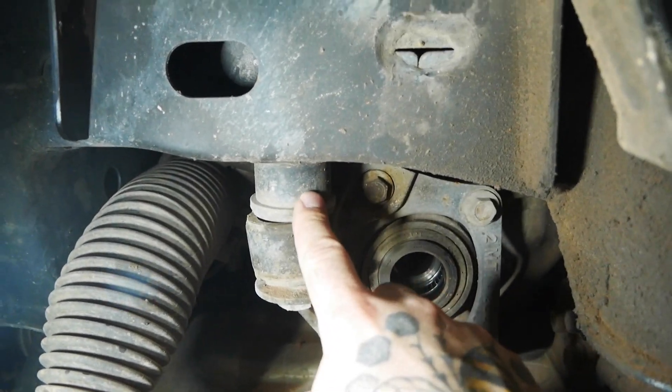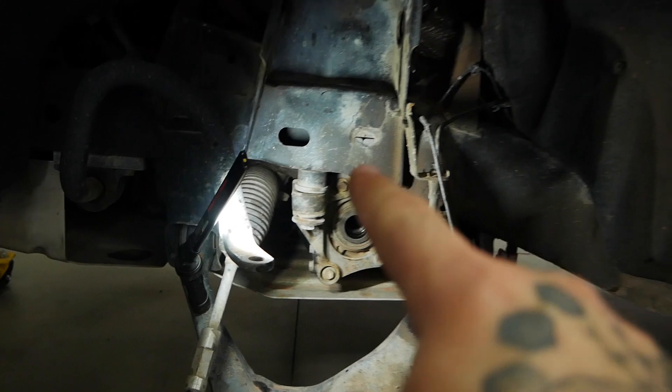Like I said earlier, I'm going to remove the diff spacer. I don't know where the shorter bolts are, so I might just flip the spacer to the bottom and continue with the long bolt — I think the bolt goes through the frame actually. There's one of these on each side. Instead of the diff being level, it tilts it down a little bit so you don't have as sharp of an angle on your axles and CVs. But mine still tear, so I'm going to try removing it completely. The annoying part is really dealing with the CV boot because it's an absolute mess, but we got the whole thing apart and we're past the point of no return — everything's off, just have to replace some stuff and bolt it back together.